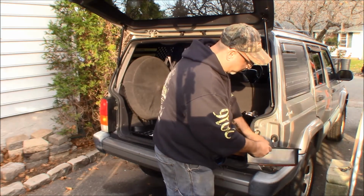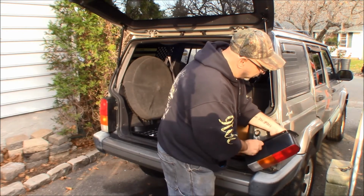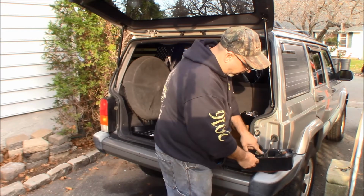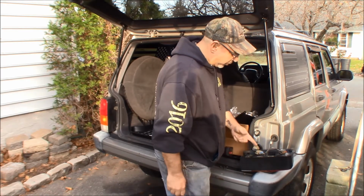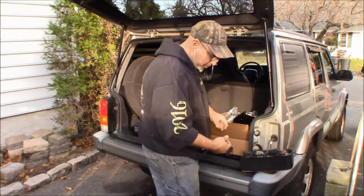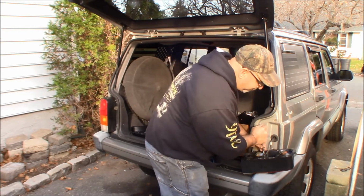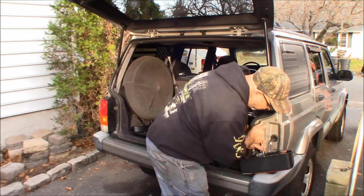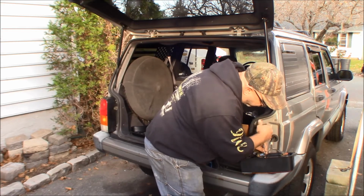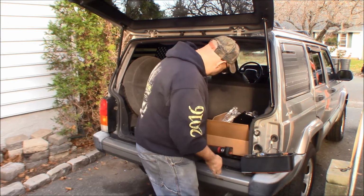So we're going to pull out our bulbs, and they usually be like a quarter turn to get them out. These are in here pretty tight, and they're retained by a little screw there. It looks like it might be, I don't know, like a 7 or 8mm. I'll have to get something for that. 7mm. That sounded like a screw breaking out of brittle plastic in these 20-year-old light sockets. So we got the screw in the retainer.